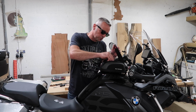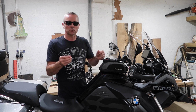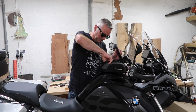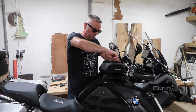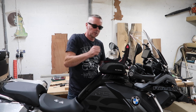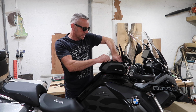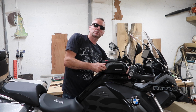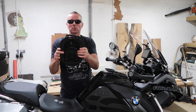So I've got my 4 screws and I'm just going to drop them into the holes, locating to the metal location positions. I'm trying to keep this video as short as possible, so I'll probably time lapse this bit. Now they're all in place, get your Allen key, tighten them up. So once all your screws are in position, you then get your vapor barrier, put it over that's undamaged, velcro it together, zip your bag up, put your finger underneath, grab hold of the pull cord, if I can reach it with my big hands. The bag pops off and there's your mechanism bolted inside.